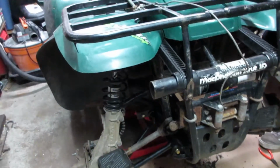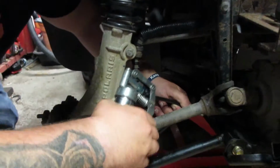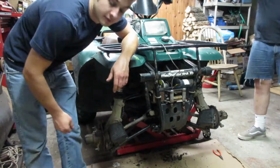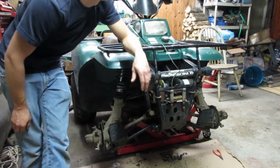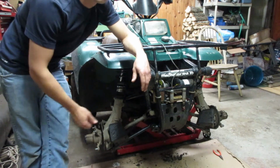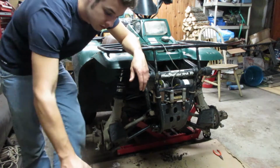We're probably gonna grease up these U-joints too. They probably haven't been greased in a while, so we're gonna just grease it up. It's pretty much the last step, and then throw the wheels on. Alright, it's done. No play. Greased up. Feeling good. And it's wheel time. We're going to throw these wheels on and then we'll close this puppy out.